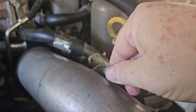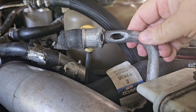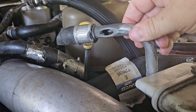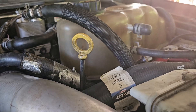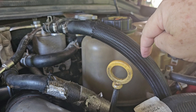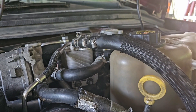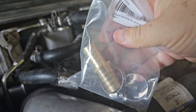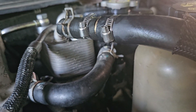The problem was it was actually rubbing against the CAT tube down in that space. If you've got a leak that's weeping down in there, I figured maybe it was from the radiator side where it seals onto the aluminum, but nope — this was the cause. It needed more protection, like a rubber pad or something between them. All we did was put in a new fuel cooler pump and run a straight 3/4 radiator hose down to the output discharge of the pump. Then we used a 5/8 to 3/4 barbed adapter — ordered on Amazon next day — so it goes back to the 5/8 hose. Then we burped all the air out of the system and filled it back up.